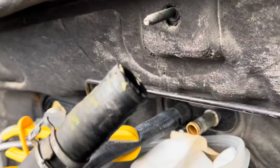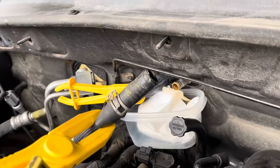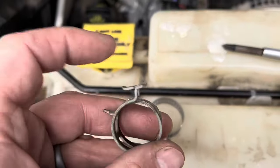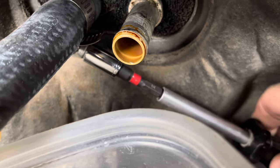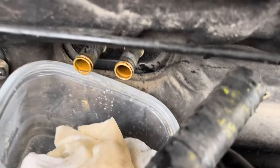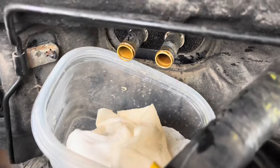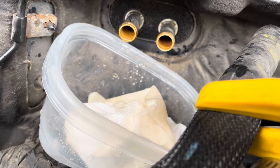The next fitting is the screw type fitting, that should be a lot easier to get off. I'm gonna replace the other fitting with the screw type fitting — this is a new kind of fitting, picked it up at the hardware store, stainless steel. The nice thing about these new fittings is they're 5/16ths so you can use just a regular little ratchet to undo them, very easy. I'll put that there to catch the coolant but wasn't quick enough. I'll clean off the nubs there first too.